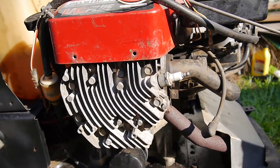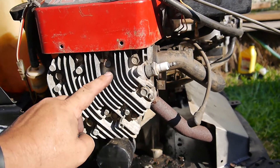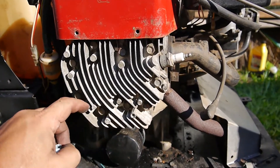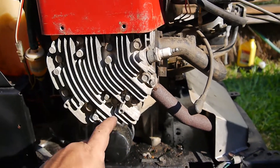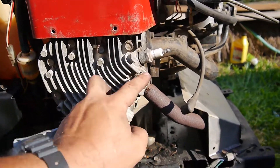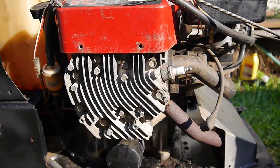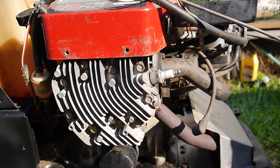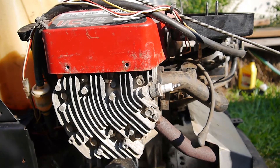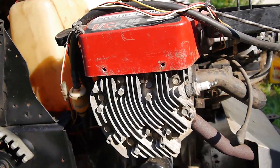There she blows. Just when you're bolting these back on, get them snug all the way around and then follow a crisscross pattern — one, two, three, four, five, six, seven, eight, something like that — go around in a crisscross and then hit the two farthest ends. Just do that on both sides and it's done.